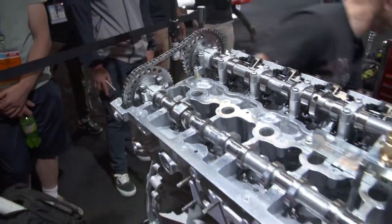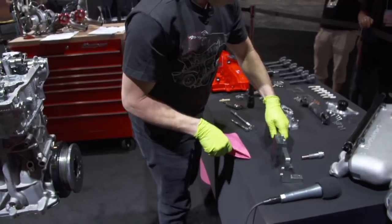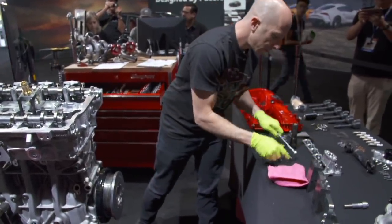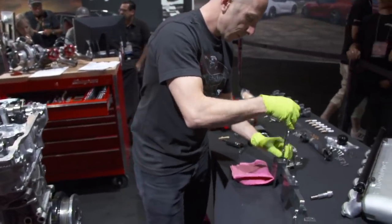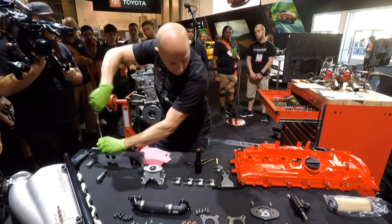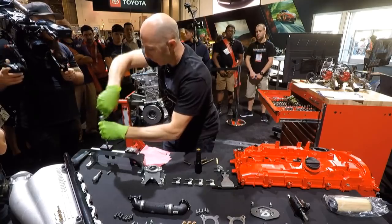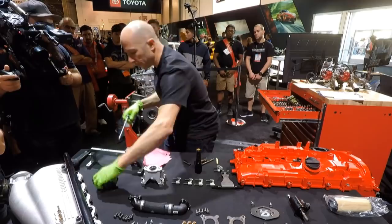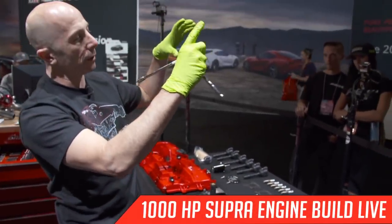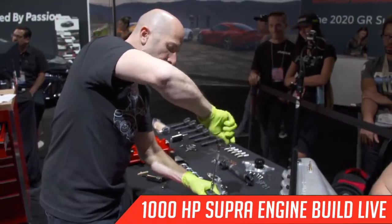But to confirm it, you put on the other special tool, which is this one. So this big bridge here bolts to the head, which we'll bolt on in a minute. And then these teeth grab onto flats on the camshaft, and they lock it in top dead center. It's a little bit cumbersome, but it's super positive. Like old engines I worked on with timing belts, you kind of line up these vague marks, and then you line up the cam gears on the plastic cover, and it usually works pretty well. But it's not always super positive.